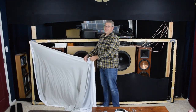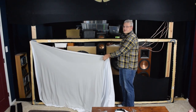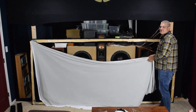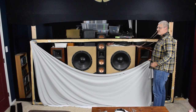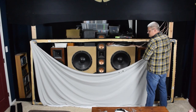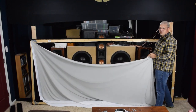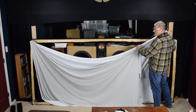Some people ask: should I have the gray front or the white front? Maybe if you're dealing with ambient light you might want a gray front just to help with your black levels a little bit. If you've got a fully light-controlled room, I'd say white would be better. Now I did measure about 5.2 foot-lamberts off my screen, which honestly isn't that bright, but my projector is also not the brightest one in the world. It'll be interesting to see what the Epson does, and also interesting to see if a brand new white screen is going to increase my foot-lamberts.